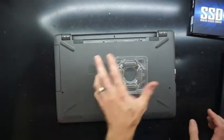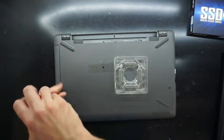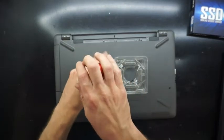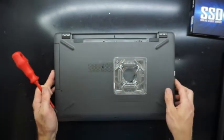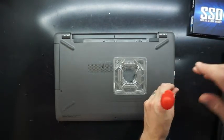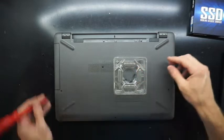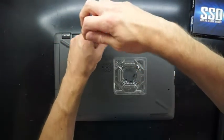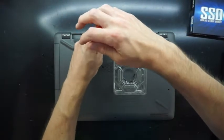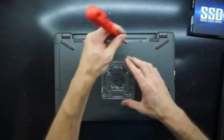To begin with you'll want to remove the battery, and then from there you should be able to use a phillips head screwdriver to remove most of the screws that are obvious. There are the ones that are uncovered on the bottom, there are the two that are hidden by the battery, and then there are also an extra four underneath each of those rubber feet, which you would probably want a small flat screwdriver or a pair of tweezers to be able to access.